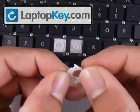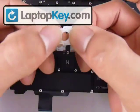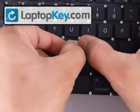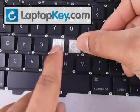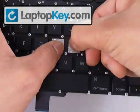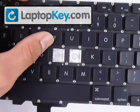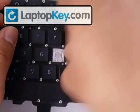Flip it over again to its right side. Align the large hook to the bottom bar on the small piece, and go ahead and put the bottom bar of the small piece underneath that large hook on the keyboard. Hold that down, then stretch the hinges towards the opposite side so the other two hooks grab onto the pins at the corners. Once you see or feel that the clips are underneath those two metal hooks, get your keycap and place it in the center, pushing down evenly on all four sides. And that's it.